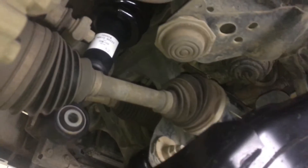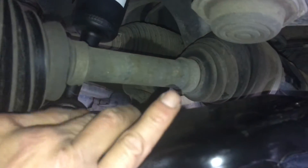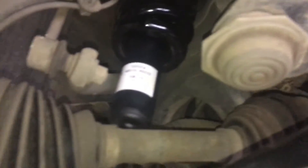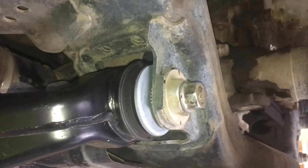We're going to swing it up — see how it goes up, and bang, just line up that bottom of the shocker. Look at this one-person job — it's a little bit awkward on your own. It'd be better if I was helping instead of just holding the camera. If I get it lined up, not too bad — a little bit of wiggling and pushing it. The nut goes on the other side. Then these two bolts up here — 19mm they are — nice and tight on these ones as well. And that one at the bottom of the shocker should always be tightened on the ground in a neutral position for the suspension, so you're not twisting the bushes.